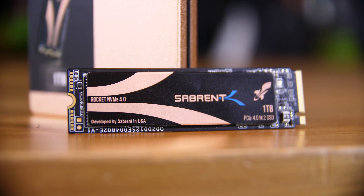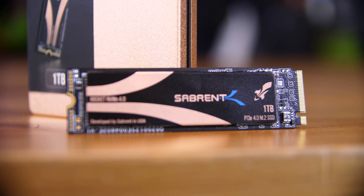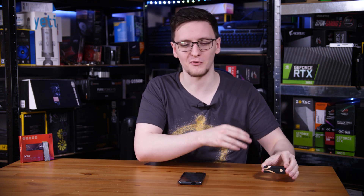But none of that really explains why this thing actually exists. It's a PCIe Gen 4 drive, which means you can only use it in a small subset of motherboards to get the full performance, and yet it's barely faster than a good Gen 3 one, and costs ever so slightly more than early Gen 4 drives like the Sabrent that perform much better. I'd much rather spend £5 less and get four or five gigabytes per second rather than £5 more for what is essentially just a really good Gen 3 drive. The SM2267 controller just doesn't close the gap enough over a good Gen 3 one, so I'm left feeling confused.